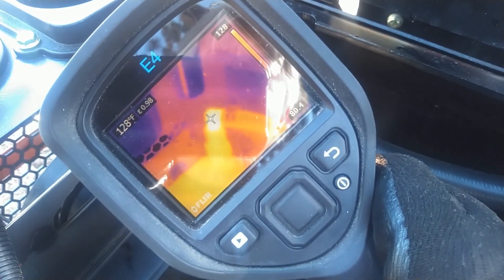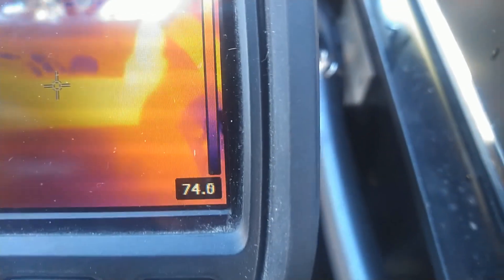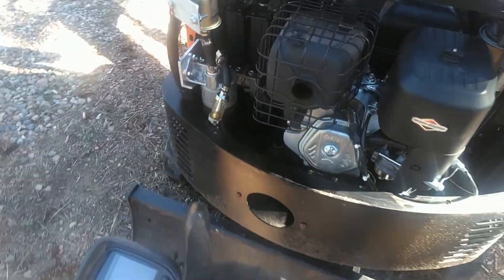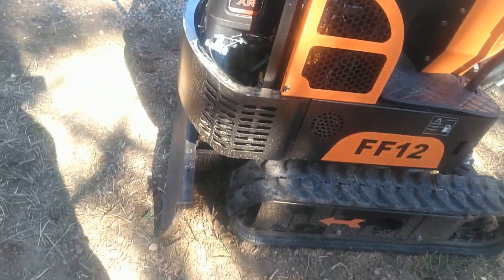Looking at the thermal camera: the input to the radiator is about 128°F, and I've seen it as high as 132°F. The input to the pump is 106–107°F. Looking at the radiator itself, you can actually see a thermal gradient — it's hot and bright on the entry side, and cools down as oil moves across. The radiator is doing a fine job of cooling the engine oil. This is a worthwhile project — it will filter contaminants through the filter and cool the engine oil, helping prolong engine life.